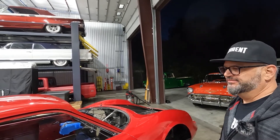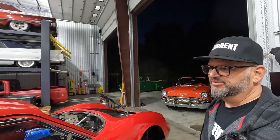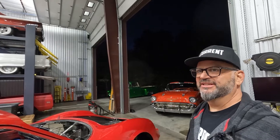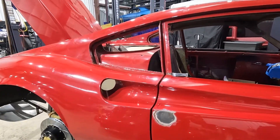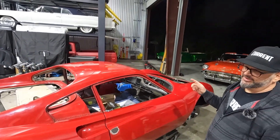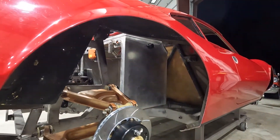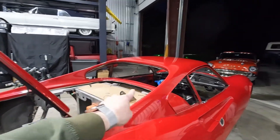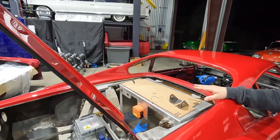It's going to be a special car for sure — power windows, full power, a lot of nice little features. Now this path through here — is that the old air intake? Correct, those were the old air intake passages on both sides. And we'll be using those to cool the motor and the battery. The battery will be mounted back in this area. So it'll be forced air shrouded from the rear, and possibly shrouds going to cool the brakes in the front. This is the only battery box needed, and it's mounted where the original motor would have been — so we have a mid-engine type feel of weight in the car.